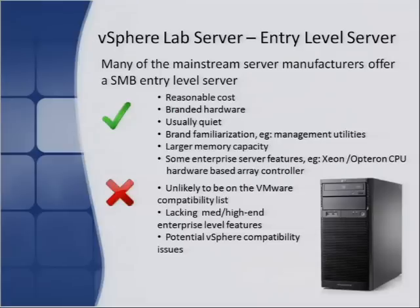With VMware 3.5 there were some compatibility issues, but right up to vSphere 4.1, no problem at all — you just put in the CD and it sees all the hardware. The hardware's not on the official compatibility list, but it works. Also, if you've got a small office or are running it in your lounge or basement, it's very quiet and doesn't generate a lot of heat unlike enterprise servers. My ML-110s consume around 80 watts of power, maybe 110-115 under load. If you're going to run enterprise servers 24/7 at home, it's going to hurt you in the pocket.